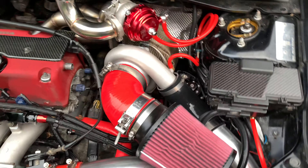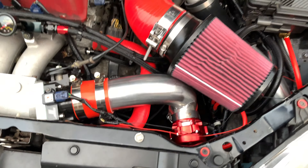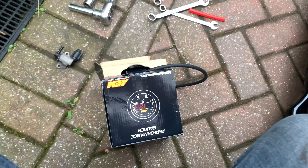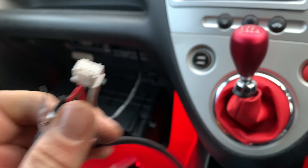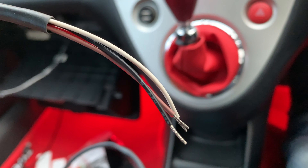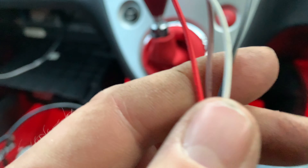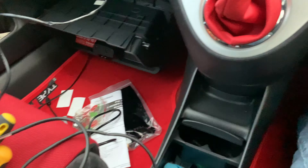We're all done with the vac lines in here. That's wired up. Now we can do this — that is the last thing to do. Many hours ago I ran the wire through. Let's go to the boost gauge. One plug and one set of wires. I've got the instructions for them. I don't understand why there's four wires — one must be like an ECU out wire. I'll have a quick read of the instructions anyway.